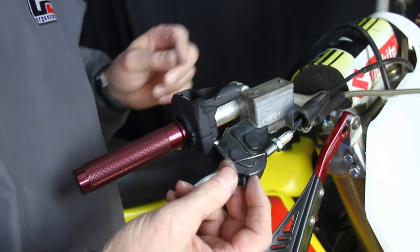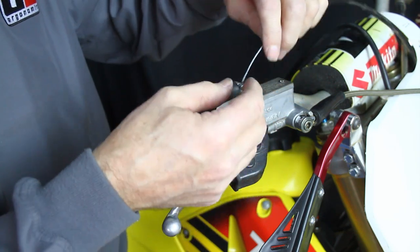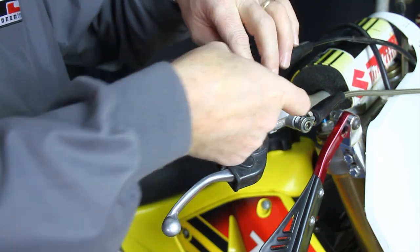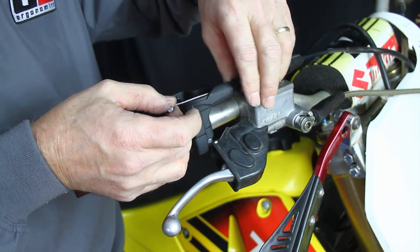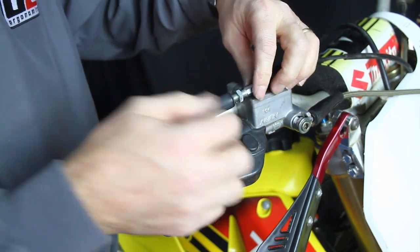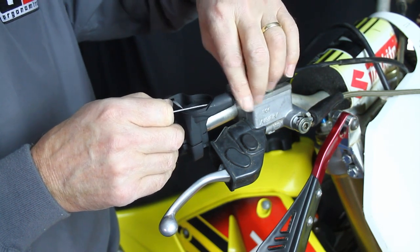We need to take the supplied reducer, because on a Japanese motorcycle the thread area is a different size. It has a slice in it — we install the cable by sliding it in through the housing and pulling out whatever slack. We then gently turn in the reducer, just holding the slack a little on this end so it doesn't get into the slot of the reducer. Once that's turned in, finger tight is plenty. We'll back the jam nut off and turn the adjuster all the way in, since we don't yet know how much adjustment we need.